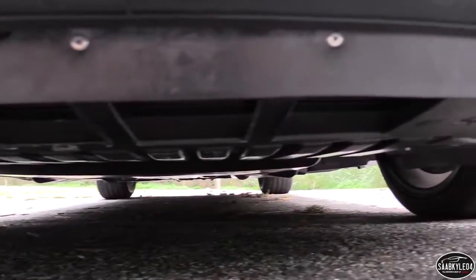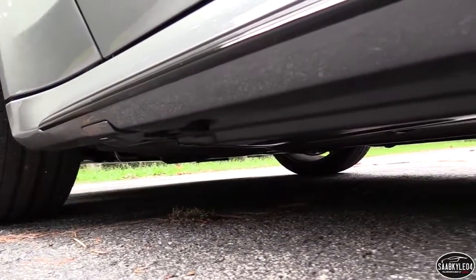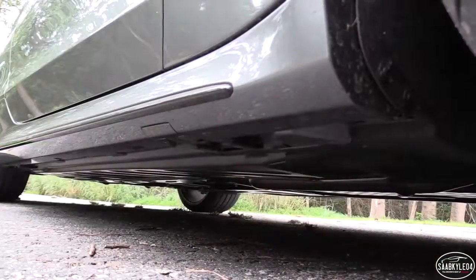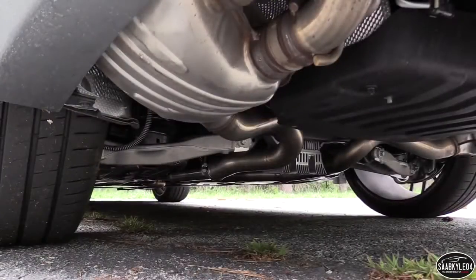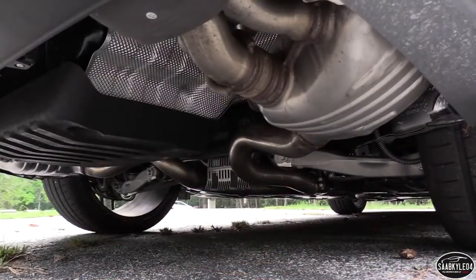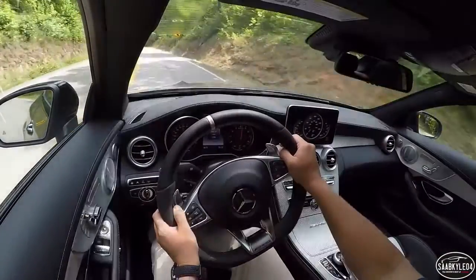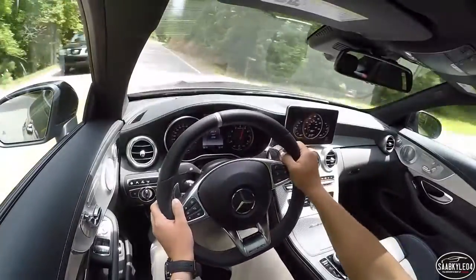On top of that, the coupe features an exclusive rear axle and subframe design that you won't find on any other C-Class. With a 1.7 inch wider track, amongst other revisions to increase rigidity even further, it provides better wheel control in conjunction with greater negative camber. The sedan more or less shares its general rear suspension design with the non-AMG C-Class, of course with updated geometry and AMG-specific tuning. Three-mode adaptive dampers firm or relax the suspension for reduced body roll and greater comfort when desired.